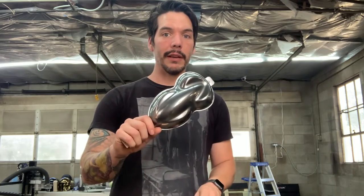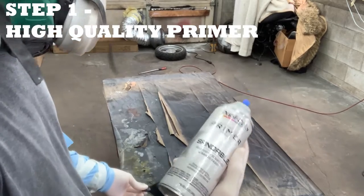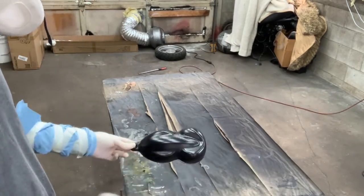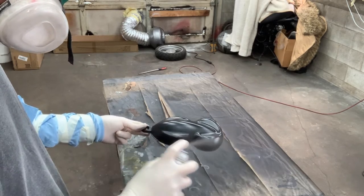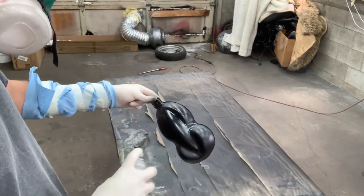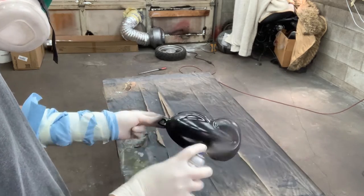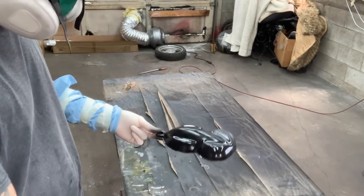With all that out of the way, let's go ahead and get started with showing you how to spray this stuff. The first thing you're going to want is a nice high-quality primer. In this case I'm using the Duplicolor Automotive Primer, the Sandable Black, and I'm just going to apply a medium coat — not super wet, not super light, just a nice medium coat. You can also use a 2K primer or a lot of other kinds. I tend to steer away from any enamel-based primers like Rust-Oleum. Just lightly apply your primer until your piece is nice and covered.